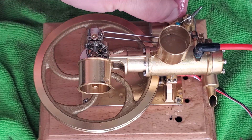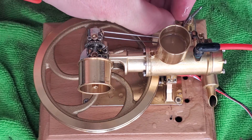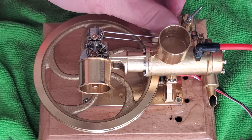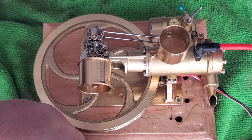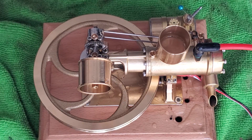I'd say that we made it through quite a ways there, and this other ignition module seemed to work. My suspicions about the original module burning out the hall sensors is true, because the one that I built here is using the replacement sensors I bought off eBay — that other module was burning up real bad. So I'm real glad that this is working.